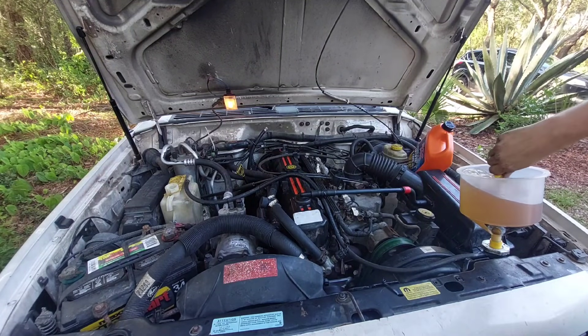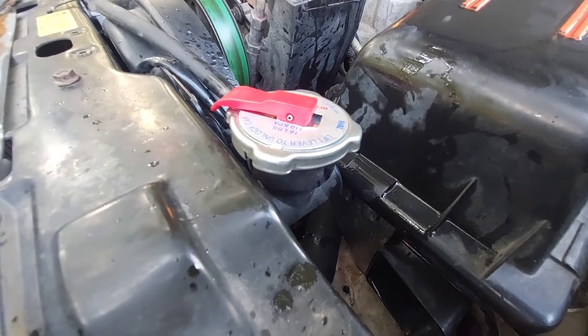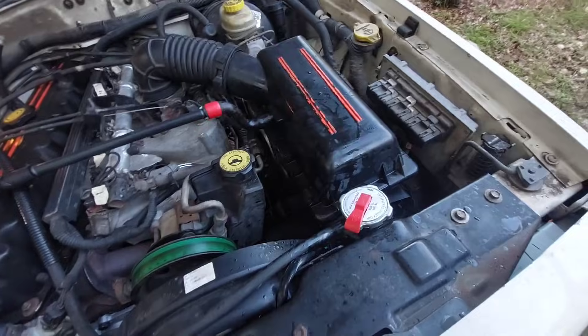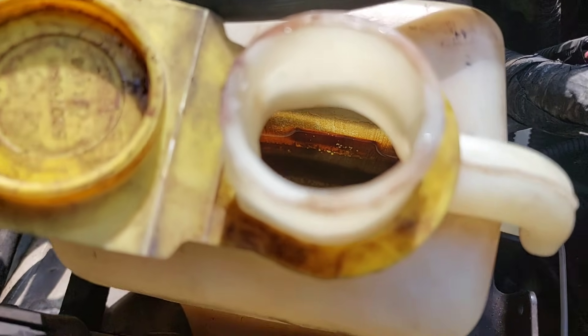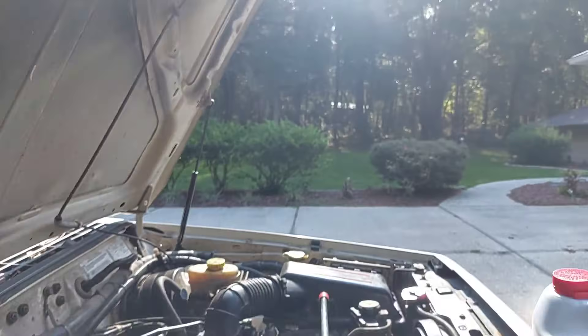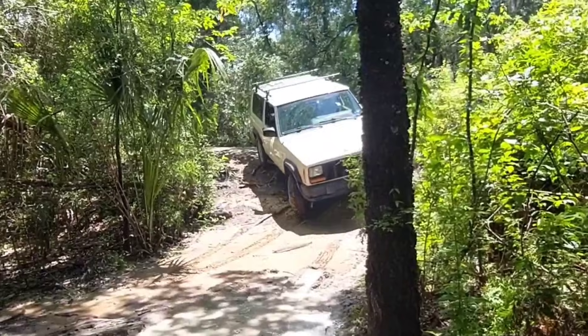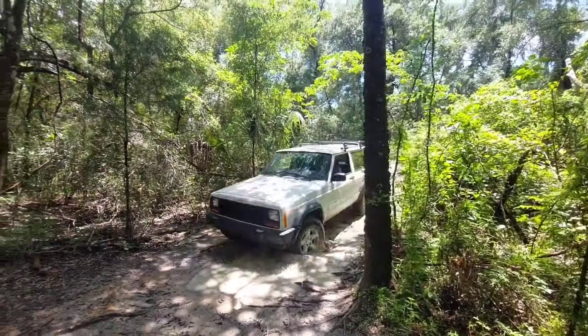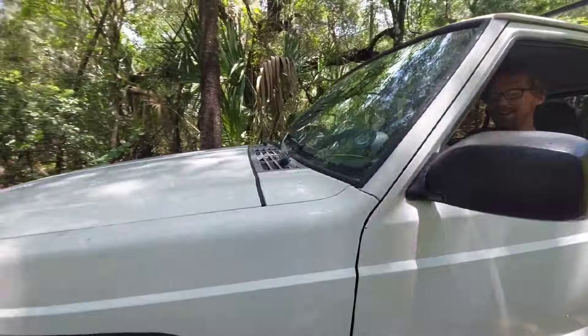When the coolant stops bubbling, put the stopper in the funnel and install the normal radiator cap. Put the extra coolant from the funnel right into the overflow tank. The overflow tank may be pretty full — that's fine, because when you take the funnel off you get a little more air in the system. Now test drive. Over the coming days, periodically check the overflow tank, keep it at the fill line, check for leaks, and watch the temperature gauge. That's really all there is to it — hopefully this video gets you back on the road.